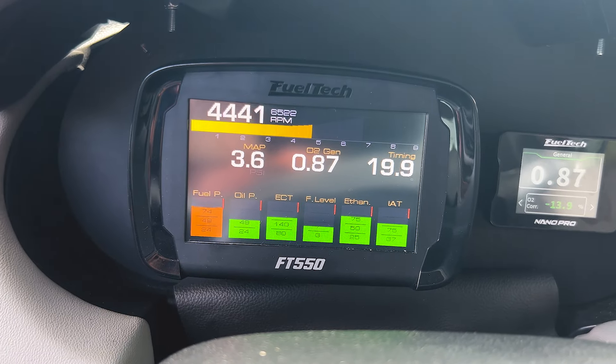I'm really happy with the new setup — the cams, the turbo. The turbo's kicking in probably about 700 RPM sooner, which is awesome. However, we're running out of injector and fuel pump at about 21 pounds of boost. After about 21 PSI our injector duty cycle starts going past 85%, which to me is too much, and our fuel pressure starts dropping. From a baseline of 58 PSI we should see one PSI of fuel pressure rise per pound of boost, but once we get to about 21–23 PSI it starts to taper off, down to about 50-something PSI at the fuel rail. The fuel injectors are pretty much just open, spraying as much as they can.